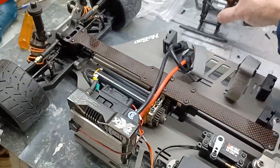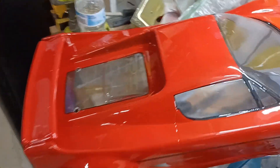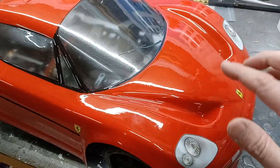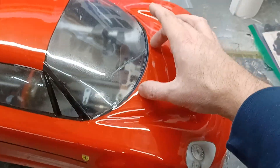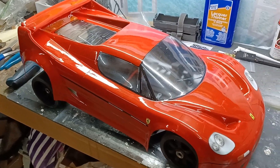People will figure out other things too. I was trying to install this Ferrari body — look at the rear body posts, it's ridiculous. The fronts happen to line up right on the side of the fake air vents for the hood, which is terrible — you can't really get a hood pin in there going sideways. I think if I move it to the shock tower, which lines up right about here, I can have one on each side and that should work.